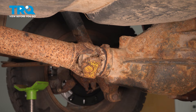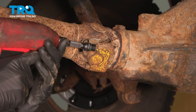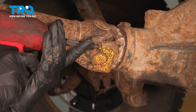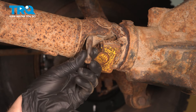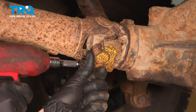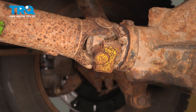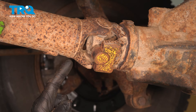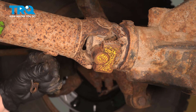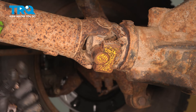We'll be using an 11-millimeter. As you remove the bolts and the caps, make sure you give them a close inspection. If it looks like anything's rotted or damaged, go ahead and replace it. Keep in mind, as you remove the final side, there's nothing else holding this end of the driveshaft into the differential — it could potentially fall out. That's what the support is for.